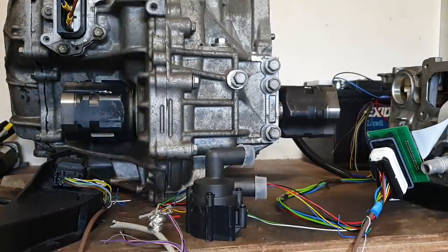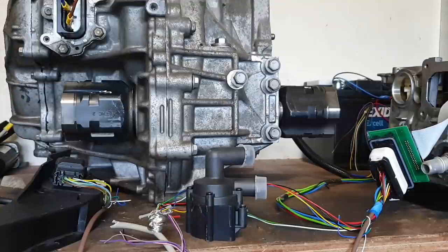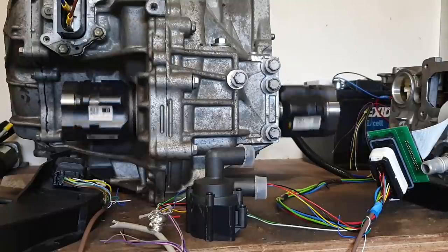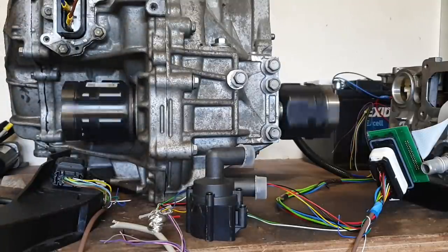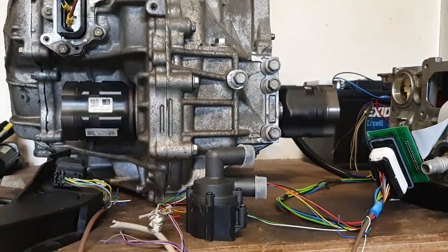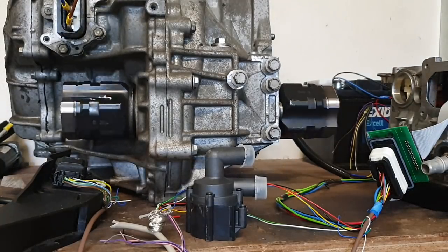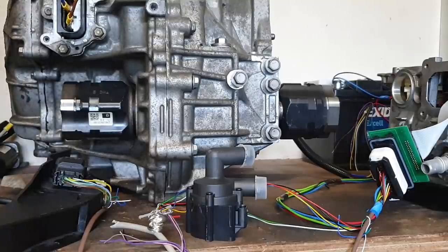Now, what had happened, okay, if we went to our parameters and we said, oh, well, I'm still not near there. What if I decided that I wanted a sync offset of 20,000? Let's say we had done an original jump to 20,000. So back here, I'm going to go for our old favorite, the 3 amps again. Oh, my God. Now we're spinning really easily, but we're spinning backwards. Okay, when we overshoot our sync offset position, we will flip the direction of rotation.